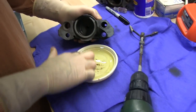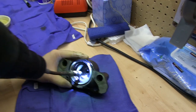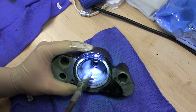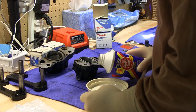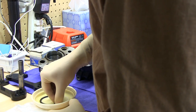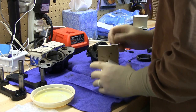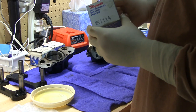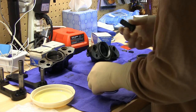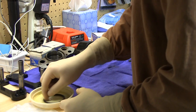Use brake fluid and brake fluid only to lubricate your honing stones. Everything gets lubed with brake fluid — a little brake fluid in a dipping pan. The square cut seal goes in the caliper cylinder groove, nice and smooth all the way around. I've got two kits here: original equipment Mazda RX3, and the Raybestos WK-1114 pro-grade kit. The pro-grade kit comes with the new rubber boot that goes down the shaft. In my opinion, you need that.